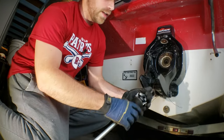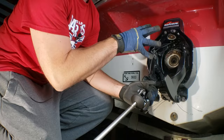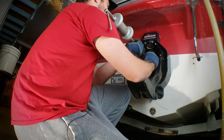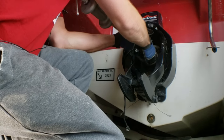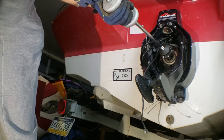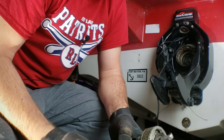With these jaws on the attachment, it's a little finicky to get them in there, but you just grab them all together and feed them in through the opening of the bearing, then spin this cup tool down. That forces them outward so they grab onto the inside race. At this point you're just kind of brute force — you slide this in and whack on it. I sound like you're breaking your boat, but I promise you're going to get it.